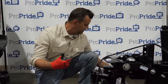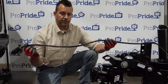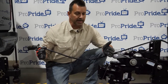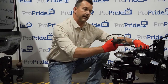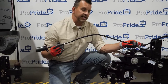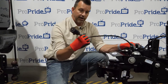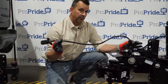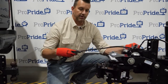Why would you possibly need this? In my particular trailer, this is actually plenty long. If you've got 18 plus inches of extra past your coupler — past the top of the coupler right here — then you're probably not going to need these components. You need to have at least 18 inches of extra on your chains, your breakaway wire, and also the 7-pin harness. If you don't, then you're probably going to need some of these items, but you can take a measurement to see.